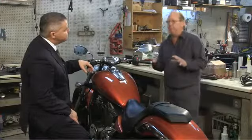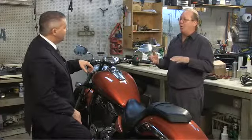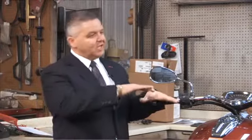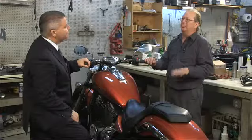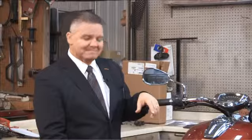So now I've stabilized the fuel, changed the oil, and got the tires up off the floor. What about temperature? You want to store the bike somewhere the sun doesn't shine on it, to avoid constant heating and cooling. A three-season room would be terrible. It doesn't matter much if it's 75 or zero degrees, as long as the temperature stays fairly constant — otherwise you get hot and cold cycles, condensation, moisture, and rust.